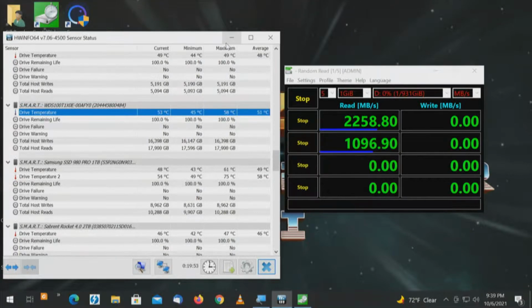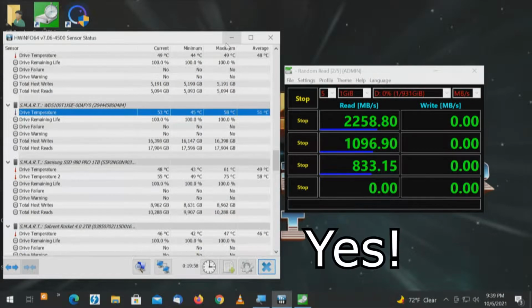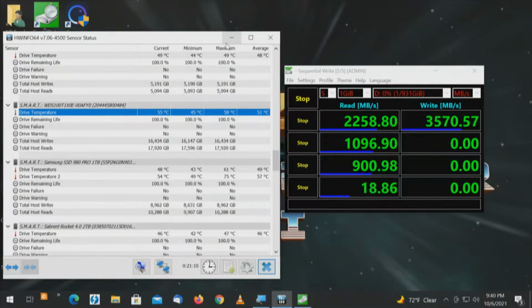That's terrible. What we may need to do, since we've updated the firmware, is power down the machine, clear the power, reboot the machine, then reinitialize the test. And the next option after repowering the system and testing again would be to put it back on the Supermicro dual M.2 NVMe adapter and test it and see what kind of numbers we get, because we know what we'll get there: just over 7,000 megabytes on the read. But that's pitiful. Yeah, that's terrible.